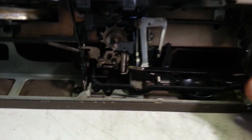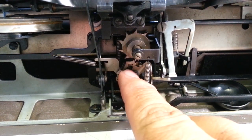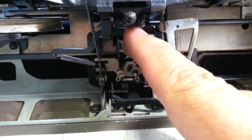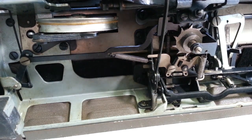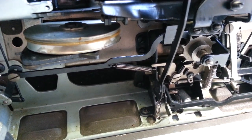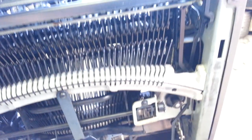Down here in the escapement, make sure everything is in order. Down here, flush everything out. Check these pads, make sure they're right. If not, replace them. Shift stops here, make sure that's in alignment. Make sure these pads are still good. If not, replace them. Flush the mainspring here. Put some fresh oil in there so it moves nice and smooth again. The oil in there is only 50 years old. Probably due for an oil change.